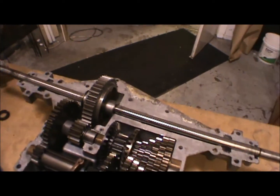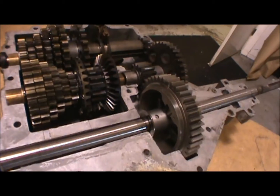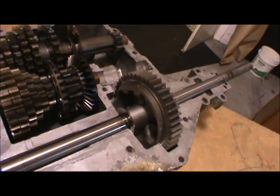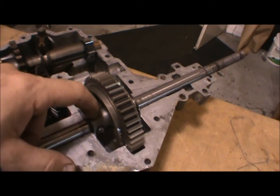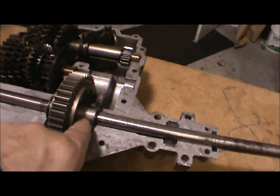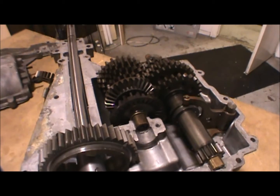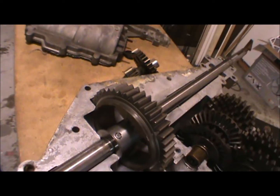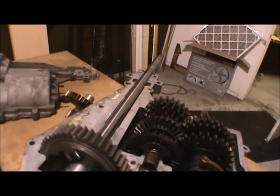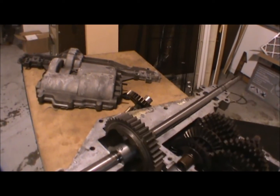But I came up with a solution. Having a machine shop, I machined a gear coupling inside there. The end of the shaft is smaller than three-quarters of an inch — it's around 738 thousandths. These are pressed tight into this. There is a quarter-inch hardened pin driven through. I also reuse the original pin in the gear itself, and that's not welded — it's just free, set in. And it runs perfectly true and perfectly flat.